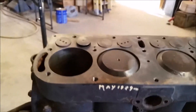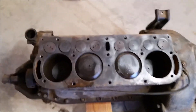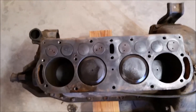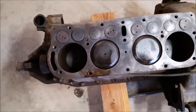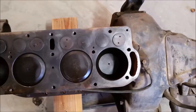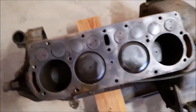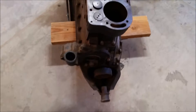I still need to do some research on that. But the good news is that I was able to look at this engine — the bore, the pistons, everything looked good. I don't see any cracks in the head or the block. Now, there is a little bit of moisture in the cylinders, but I'm thinking that's because this thing sat around for a while with the head actually unbolted. There was no head gasket on it, and the head bolts were just there, no plugs in it.